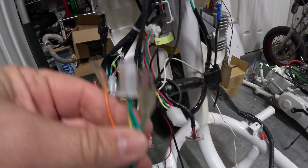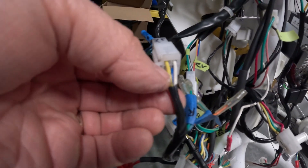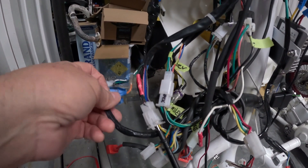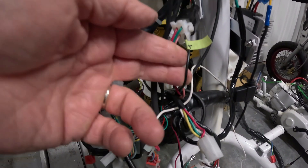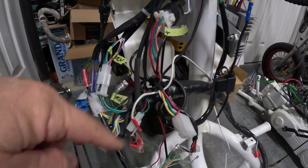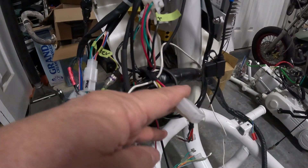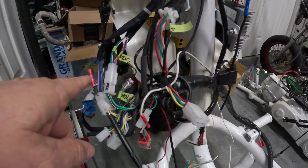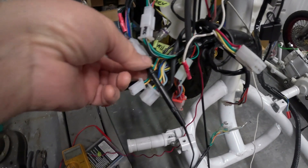All these yellow wires are your AC system. Once we disconnect the AC system from the stator — there's the yellow wire and here's the yellow wire that goes to the tail light, that's just for the running light — you have the yellow wire going to your headlight, leave that hooked up. Everything stays the same. We just have to jump the black wire, which is our 12-volt keyed-on positive, to a yellow wire. That's going to make every wire that's yellow 12-volt positive when the key's on.